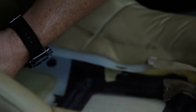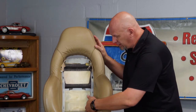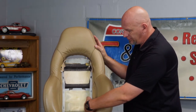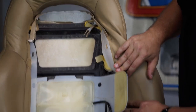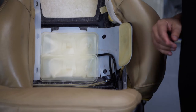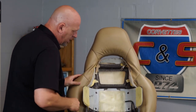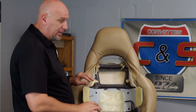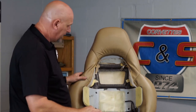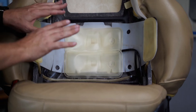Now set the seat back up. Take your fingers under this plastic and hook them a little under the foam behind it, and gently pull both sides back, letting them stay behind the fiberglass wing. Come around to the other side and do the same thing. At this point we've now exposed all four airbag bladders, and this is the point where we get to have some fun and get some working stuff back into this seat. It's a really simple procedure, but it seems to scare a few people - that's part of the reason I made this video.